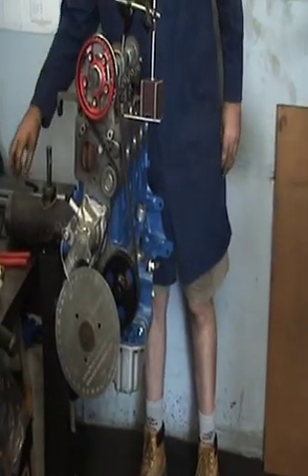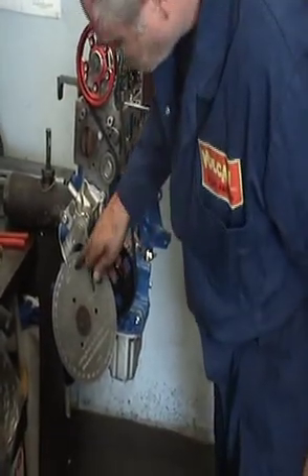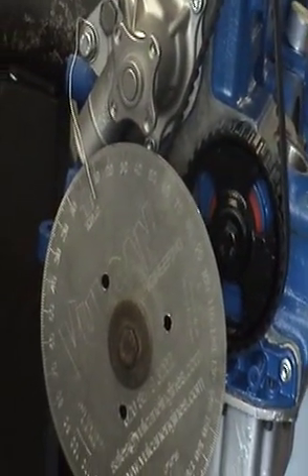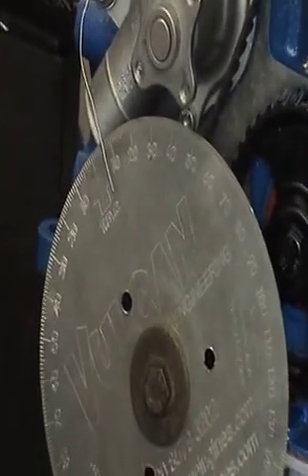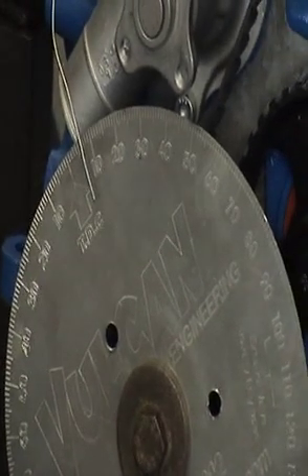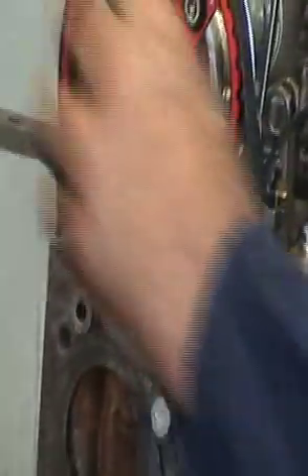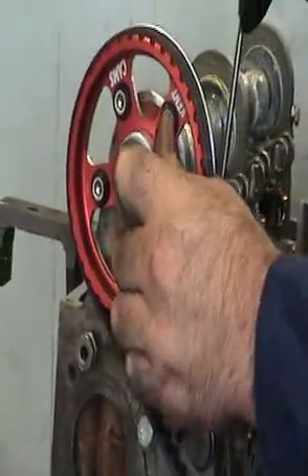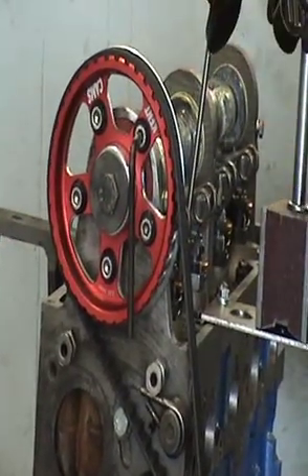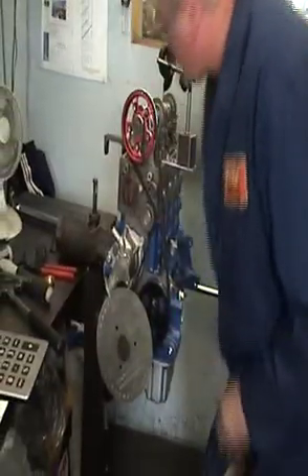What we're going to do now — as you'll see, TDC is about 8-9 degrees out. So what we're going to do is undo the vernier, and we're going to turn the crank, leaving the cam where it is, up to TDC position. And we're going to check our figures again, make sure it's right. And that should be done.